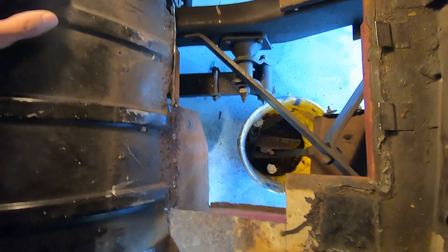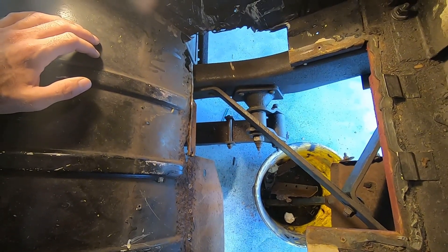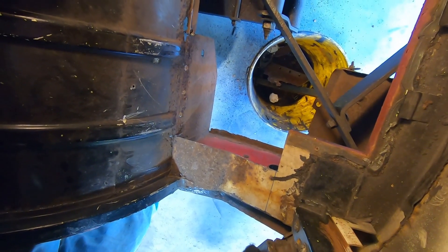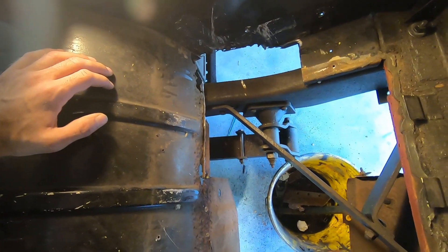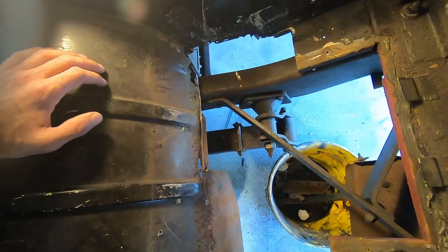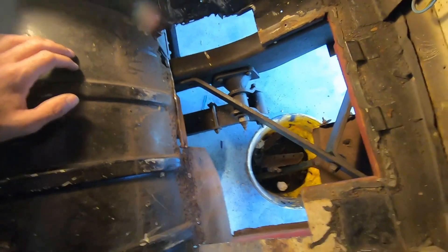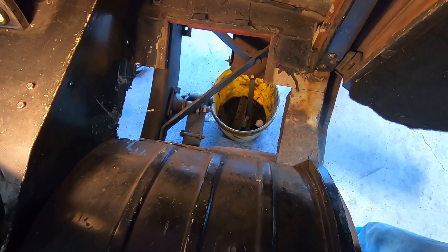I'm not in a hurry. I want it done mostly right, but without spending months waiting for it to be perfect. So I'm going to just keep chipping away, cutting these spot welds out and cutting back until we have good metal. My favorite part is when it starts to go back together, because you're working with good metal, you're welding, you're adding instead of cutting out, and you know exactly what you're working with.